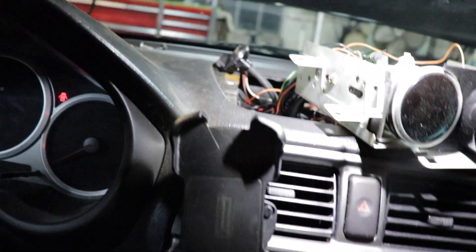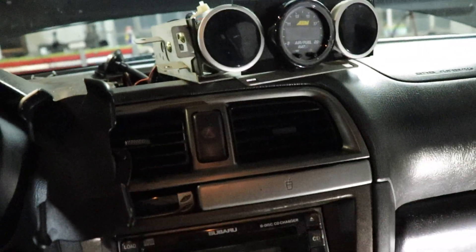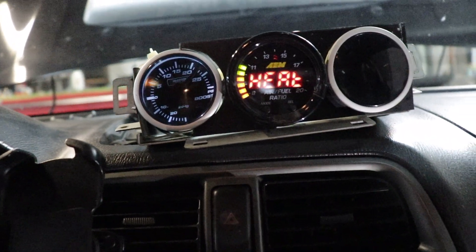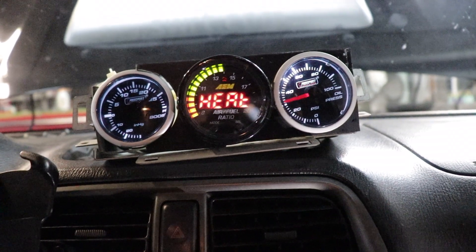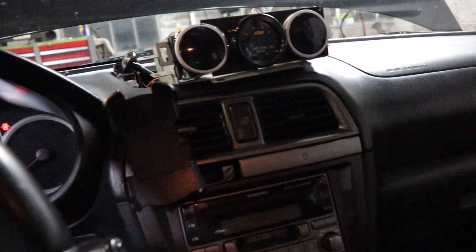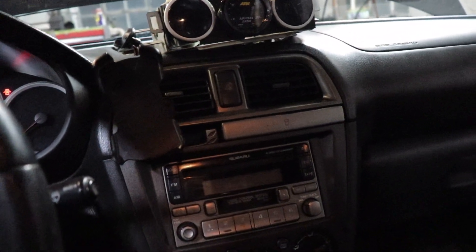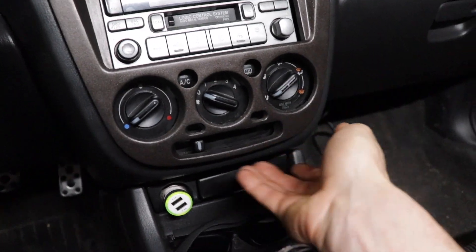All I did was feed the wire from down here, got my hand down in that hole back there and fished it in - not too difficult as long as you have both hands. So I just plugged it in. Now we're getting a display here saying heat. You can see how low the voltage is - look at how much voltage this gauge is actually taking away from the system. We're definitely going to have to get a different hot source because it's definitely robbing a lot. After thinking about it and what I had as far as hots around here that are a switched ignition hot, I'm going to use the radio, because it definitely has a bigger wire that will be able to draw more amps through it. These gauges don't take a lot of amps to begin with, but it's definitely better than the clock and we won't have that dimming function. To remove the radio faceplate, pry down under here first - if you don't have plastic pry tools, use a screwdriver with a little rag so you don't dog everything up. Pry under here first and it pops that part out, then come up around the sides and pop it out. Then you've got six screws and the radio comes out.